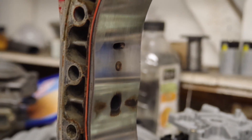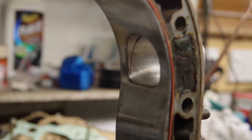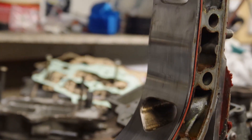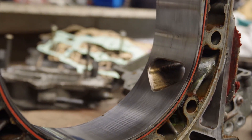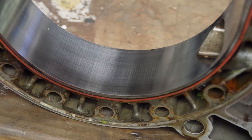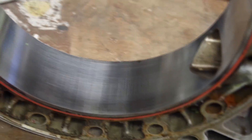Having a look at the rotor housing, the chrome looks okay, although there is a bit of chattering, especially around leading up to the exhaust port. You can tell the exhaust port has been opened up quite a bit - the width of the port is actually quite wide and there's not a lot of support material left for the apex seal, which can cause the apex seal to flex at high RPM. But it hasn't been an issue with this engine, so it's probably okay.